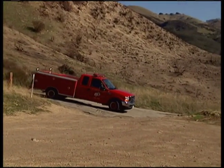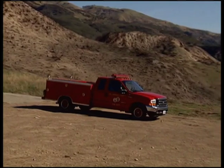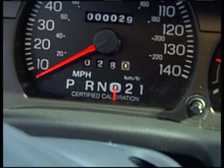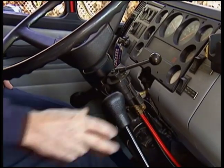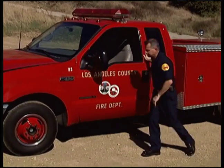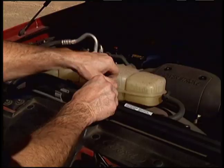Once you realize you have a flat or low tire, pull safely to the right of the roadway out of traffic. If possible, pull off the road completely and find a flat level ground. Place the automatic transmission into park; if your vehicle has a manual transmission, shift it into reverse. Set the parking brake and turn off the ignition. Most light duty trucks have the tools under the hood — check the owner's manual as some vehicles may differ. Use caution when removing tools from the engine compartment, as tools may be hot.